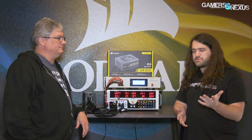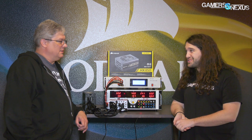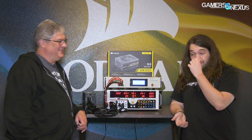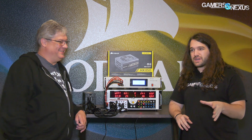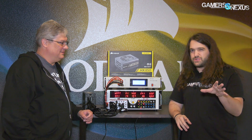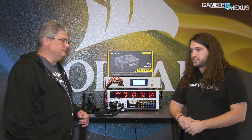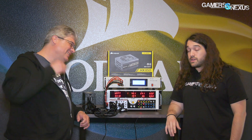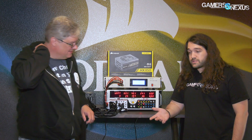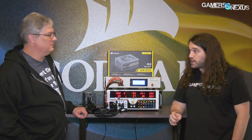We should note why ripple is important too. From an overclocking standpoint, if you get into a category where the ripple is really high, you can have potential stability issues or power delivery issues in general. From my practical experience, it's more noticeable or observable with a highly sensitive overclock. Well, it does affect overclocking more than anything because the system is so sensitive at that point.